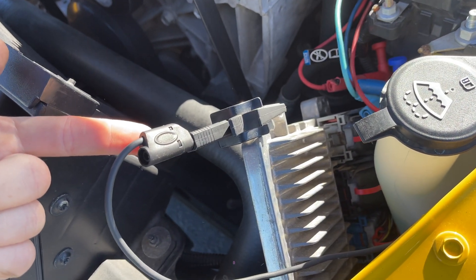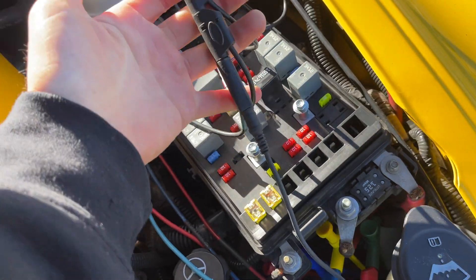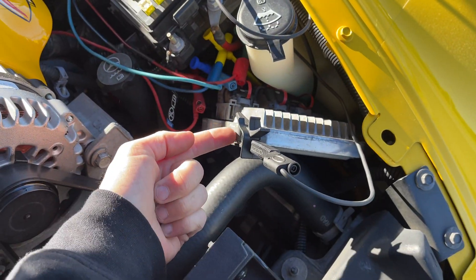Here is my reference ground. The ECM only has one ground, and the case is grounded, so I've hooked all four scope leads directly to the ECM. You might ask yourself why do it that way — well, if I lose all four powers on my scope, that could indicate a potential ground issue, since I only have one ground and the case is grounded through that ground wire. The ECM case is just sitting in a plastic housing right now, not touching anything metal.